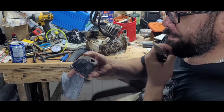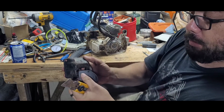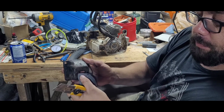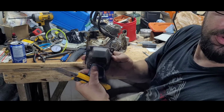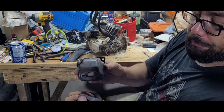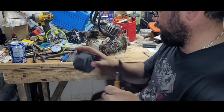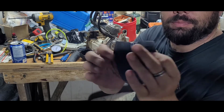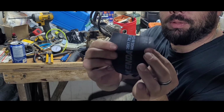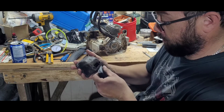Problem is now, when you cut your tube, you gotta be careful here, because if you go up to the bolt holes, I have run into issues when you try tightening down your muffler to seal it off, because the rubber wants to expand as it's being squished, like a gasket. When you're pressing down, it wants to pull out like that. Not severe like that, but that's the idea.